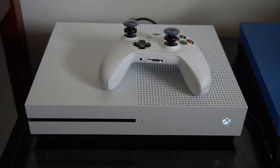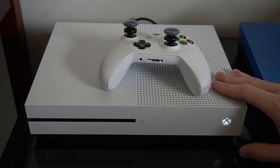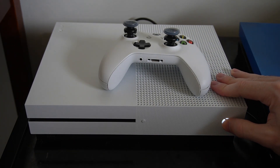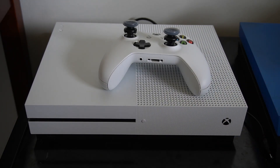I'm going to show you how to launch your Xbox One into low resolution mode right now, and this is very easy. So to get into low resolution, I have the console on right now. I'm going to go ahead and fully power off the Xbox One by holding down the Xbox button for about 10 seconds. You don't want to just tap it — that will just put it into the instant on mode. You want to fully hold it down and power off the console completely.